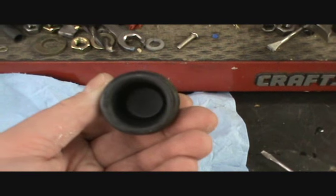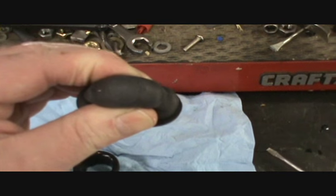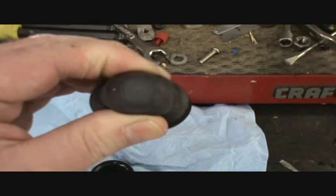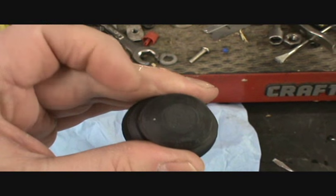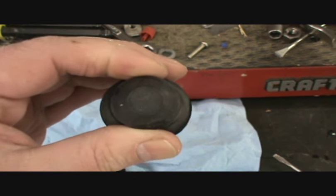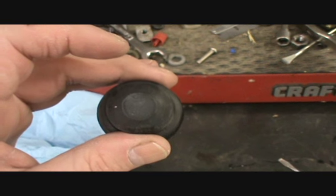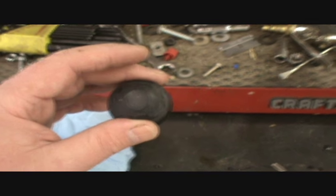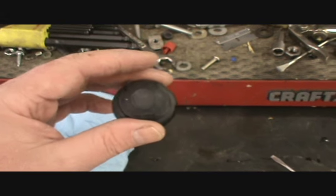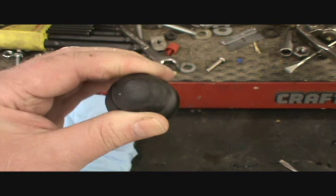What I've always done is take your new grommet — you can see it's solid all the way through. Instead of cutting the whole bottom off, you're going to squeeze it together like this, then take a pair of side cutters and actually snip off one side and one side — two cuts — and basically what that's going to do is leave a baffle in the middle so that oil doesn't directly get shot up into your breather. Since I can't do this with two hands while holding the camera, I'm going to go ahead and cut it and show you what it looks like after.